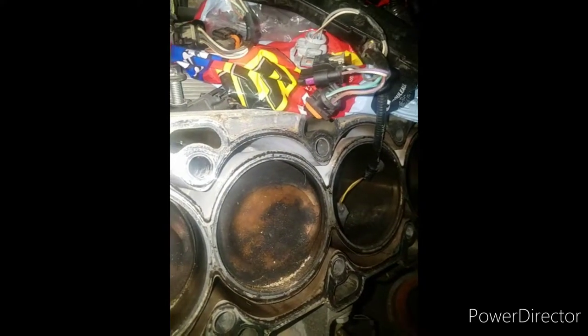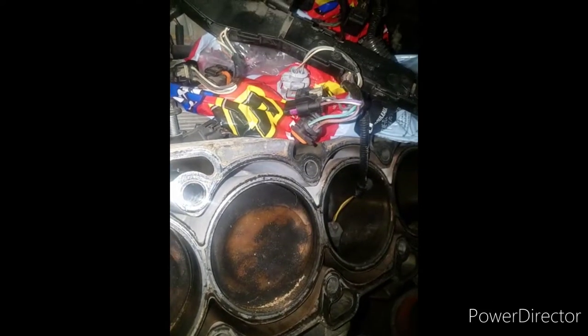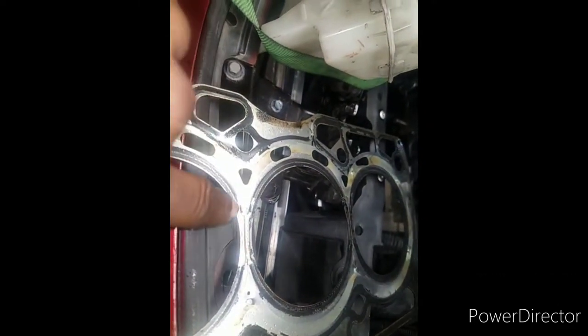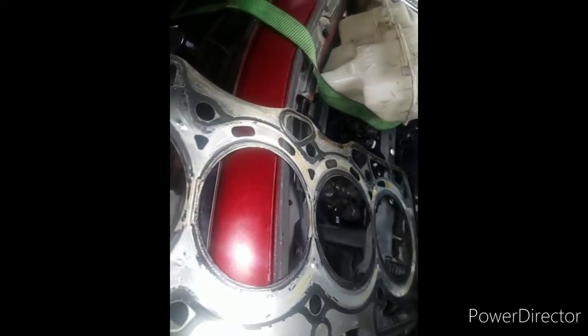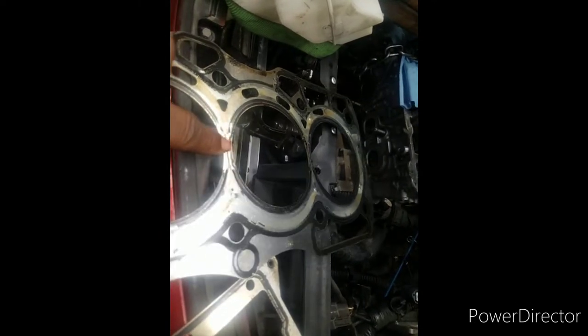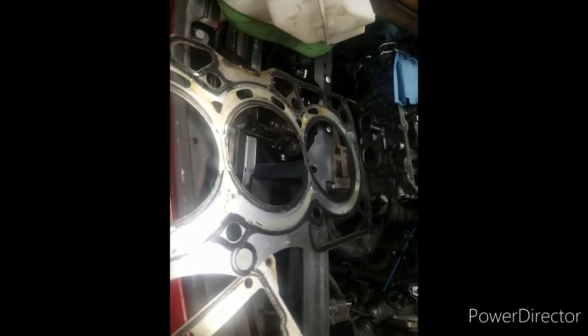What's the point of that? This Jaguar isn't sending it back through the coolant. It's sending it out the tailpipe. Now look at this. You send coolant across this area right here. This is going to make this thing blow every single time. You've got pressure building up from antifreeze here, and also the compression building up right here. And if this lifts just a little bit, that's a wrap.